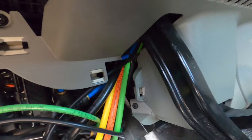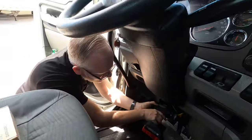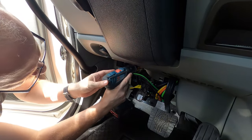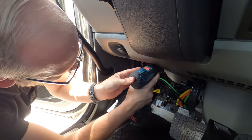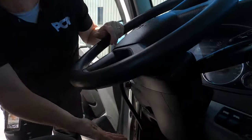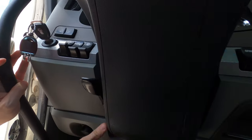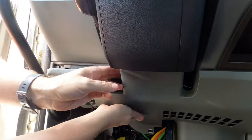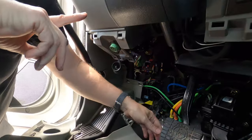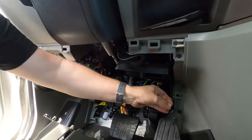On the camera you've got these nuts right here and then you've got a screw right here. We're going to take those two out. Put the screws somewhere so you don't lose them — you'll need them. Once those are out, you have to raise your steering wheel all the way up, and then this panel here just pops off. You'll see these clips will fall out — there's a place right here, just pop it right back in.